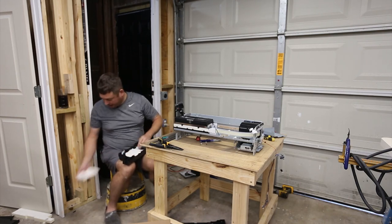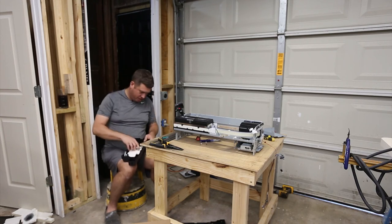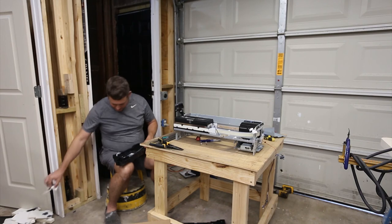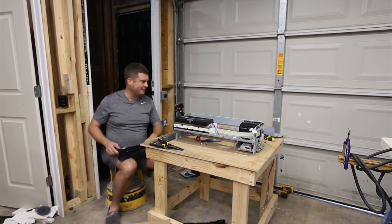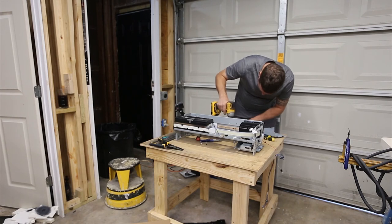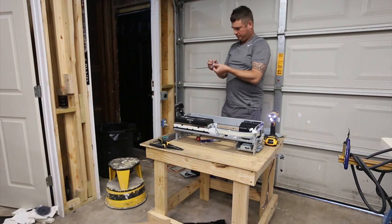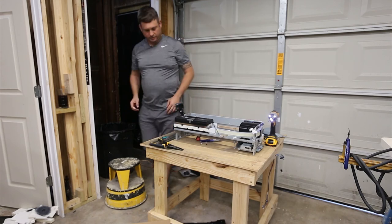Now we're going to work on the feet. One of the things we need to do is remove the foam, which is funny because we spent some time putting it back in. I suspect this saturates fairly quickly — all I've done is a basic warm-up print and I've already got quite a bit of ink in here. I'm also going to remove the rest of the ink waste tubing because I don't think I need it.